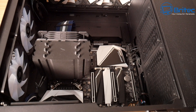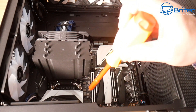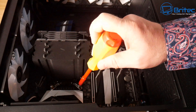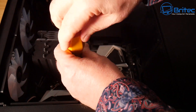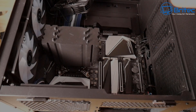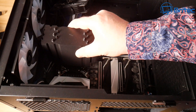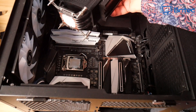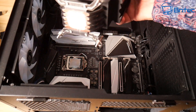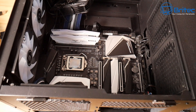We'll have to remove the fan on the cooler to get access to the other two screws. I'm not going to show you every single screw — just undo them all and then give it a slight twist. Always give it a slight twist before you remove it because you don't want to pull the CPU out of the socket, especially with AMD. Intel's not so bad, but with AMD you can pull it straight out and risk bending the pins.